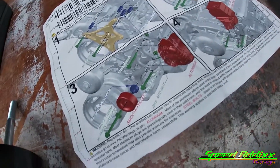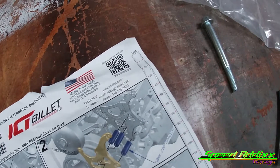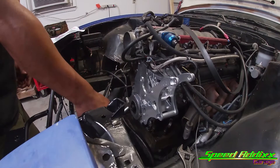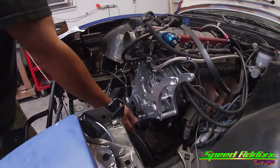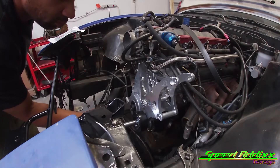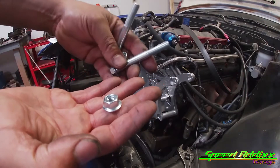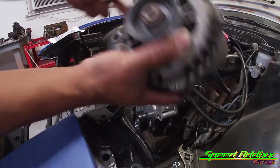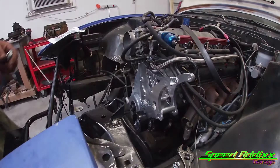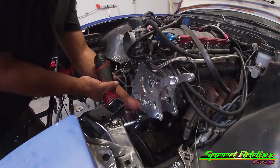It looks like in step three I'm going to need my alternator, so let me go ahead and grab it. Looks like it's going to go in there like that. When I do final assembly, I'm probably going to throw a little anti-seize on all this stuff because this is aluminum and I don't want it to gall up on me. I feel like there should be a spacer in between there. Alright, I messed up — this spacer right here — hold on, let me get it out. Remember I said I thought there should be a spacer down in between there? Well, guess what — they were right and I was right. And now we can put the alternator in. Put the nuts on there.